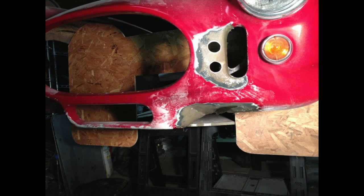It was easy to think at this point that the hard part had been done, but the fact is the front end of the car, when it went off the road, pushed a lot of dirt, and there were a number of cracks in the front end that made it very, very flexible. What we had to do is make sure that the front was on straight with the rest of the car. And so we took a 2x4 across common points at the two side doors and put a level on it, and then took a piece of plywood and screwed it to the headlight mounting, one screw on each side.